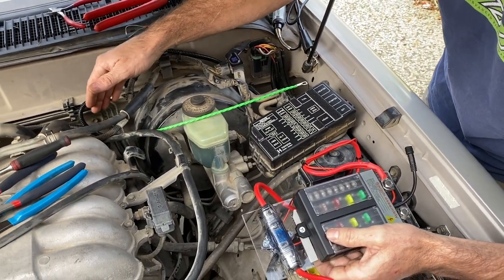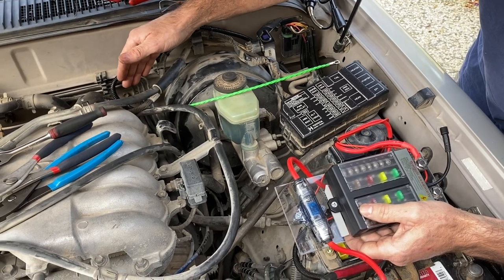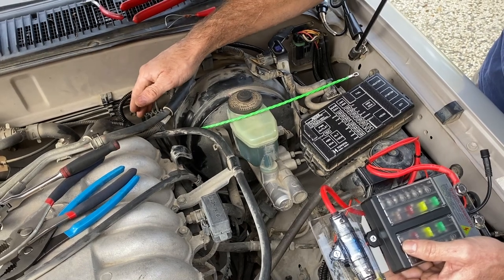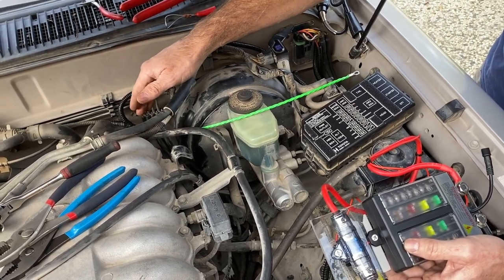The next thing I have to do is run the cable from the fuse block to the switch panel. I'm going to run it through a grommet I've used in the past — I've previously used this same grommet location to run the wire for my aftermarket transmission temperature gauge and for my Eaton E-Locker switch. I don't believe all third gen 4Runners have that unused grommet location, so if you're not lucky enough to have it, you'll have to find a different path through the firewall.